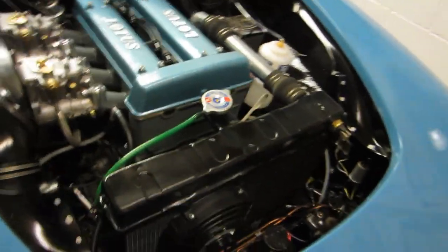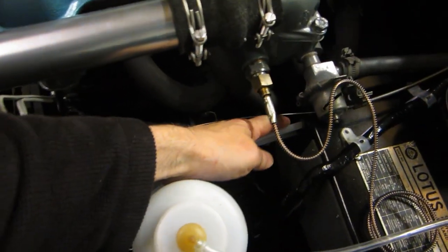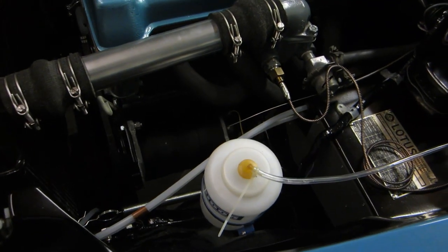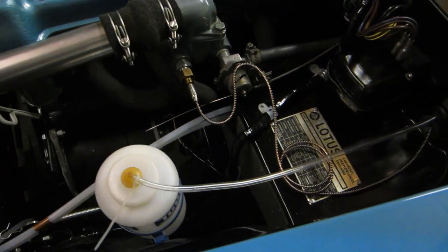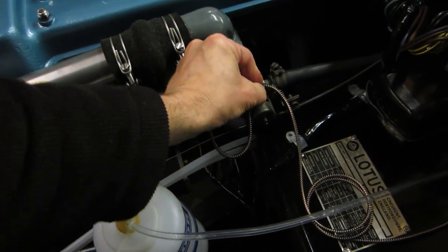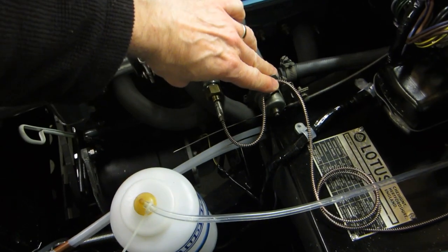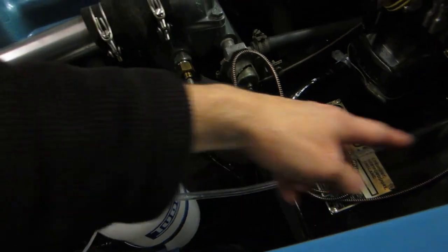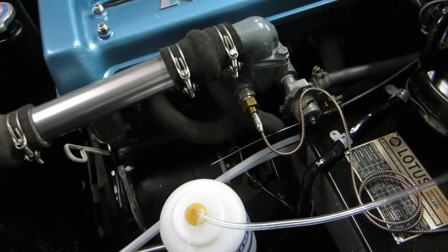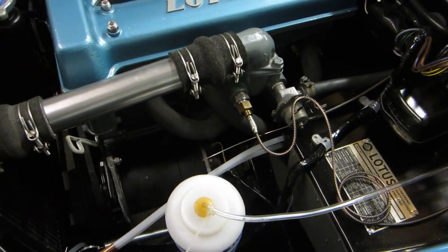The engine bay is pretty much finished. I've tidied up where these pipes go, but I think I've got the wrong material because they're melting just here — I can feel some distortion. I think the material is either too thin-walled or just the wrong material. I've got to tidy up the way this fixes — the recommended way is to clip it to this so there's no stress here as the engine moves sideways. If that's also fixed to the engine, the movement is taken up by this big coil rather than just locally here, which would cause vibration and stress at that joining point.